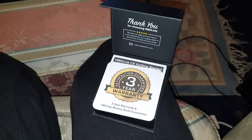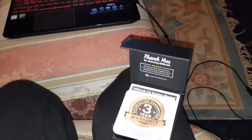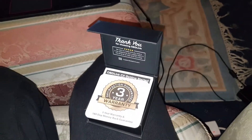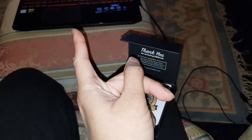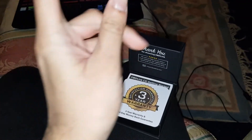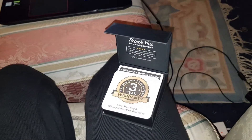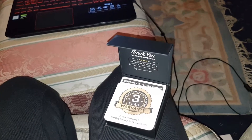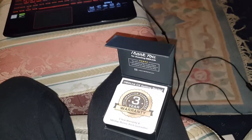The main reason I wanted this is because I wanted to code on the BMW 3 Series F30 that I got — you need a coder anyway, and this is the brand I liked when I saw it. The first thing I wanted to do was put on the digital speedometer, just in case, because I'm used to digital speed rather than watching the dials. Another reason was I'm going to change the front lights to LED, and with BimmerCode I can code it out so it doesn't check for the lights — so I don't need to get canbus resistors.